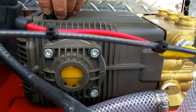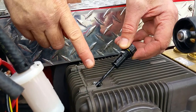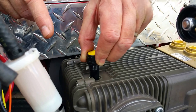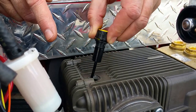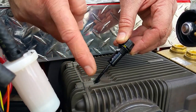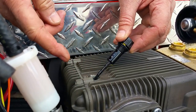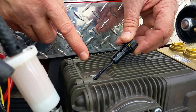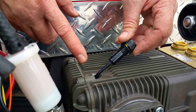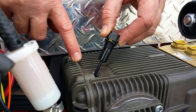To check the oil with the dipstick, instead of screwing it in, just dip it into the oil to see where the level is. Here's the notch on the dipstick — I want that oil level right up at the top of the notch. That's going to show you a higher level on the sight glass window, and that's where you want this thing to live for the rest of its life. If that's a couple extra ounces over what the factory recommends, call it a couple ounces of insurance. Use high-grade oil, keep plenty in it, and pay attention to it.